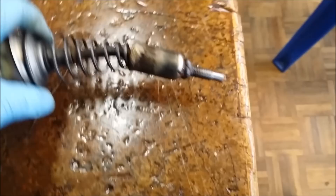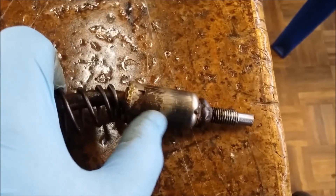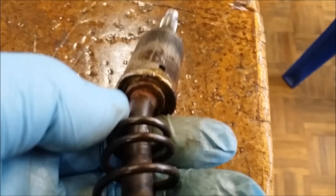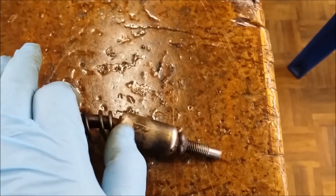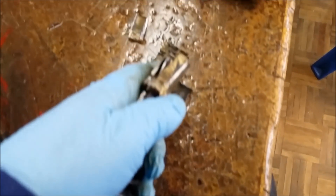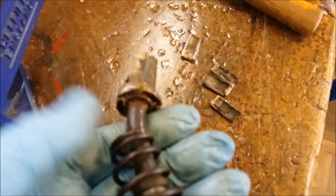I've come into work early and I'm going to do something about this shifter now. It's been welded up here, which I don't like at all. In doing that they've sort of welded this bell on — I think that's just a support for the gear shift, maybe some sort of shock absorber. I'm going to cut all this off up here to try and leave some of that original material there. So I can put the new gear shift extension to the right trajectory. I'm going to dock that off now and we'll start making up a new one. This is a mess — it's all been sort of brazed inside. This is the outer shell that I've just cut off, and the original spigot is in there and I need to get that off.